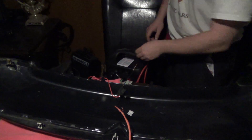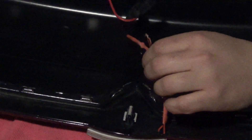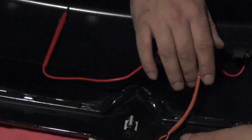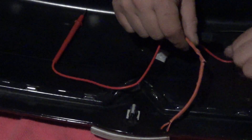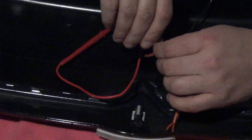I'm going to have to find out if these have a regulator in them already. The 3M tape made it a little hard to see what was going on, but the installation was fairly straightforward. You already saw the other parts taken off. I drilled two holes, put heat shrink tube on there, soldered the connection between the fuse box and the two positive connectors, and left the negatives twisted together. I am going to have to put an extension on there, and I'm not sure if I'm going to use a switch.